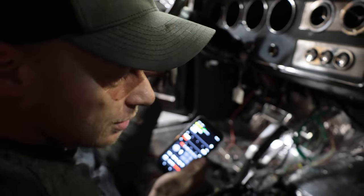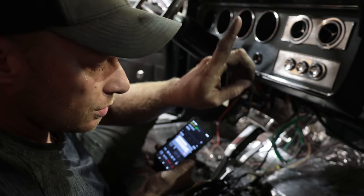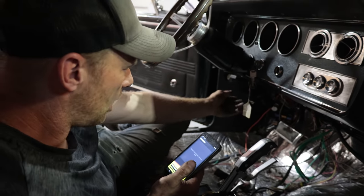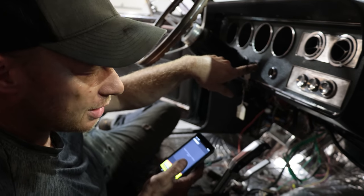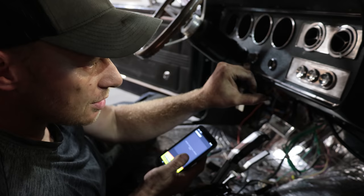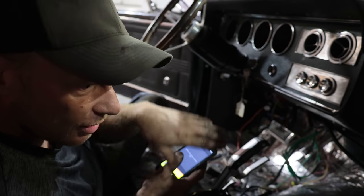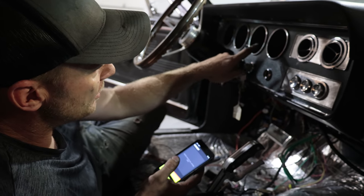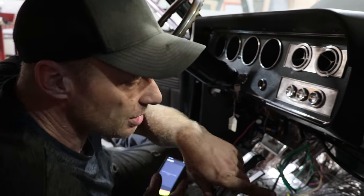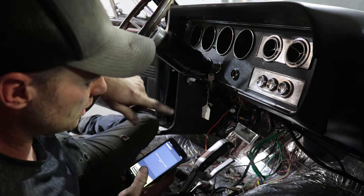I had a little bit of screwing around to do with the RPM sensor, because it's got the one wire to go to your tach and to do a nice clean signal. But the Holley couldn't read off of that yellow wire. So I had to put the Holley before the TCI sensor. And then the dash, if I added the dash before the controller, the Holley wouldn't run. So I have to run the dash off of the extra wire from the TCI. And the TCI has to be after the Holley reading. But we've got tach reading now on the dash and on the Holley.